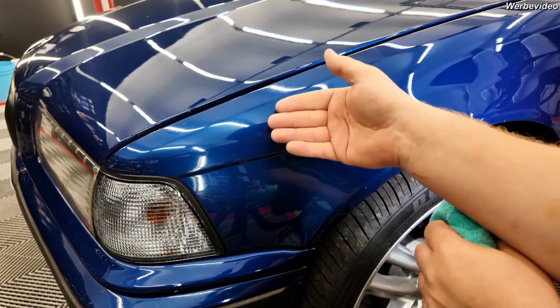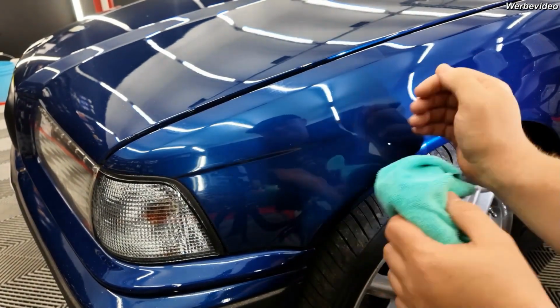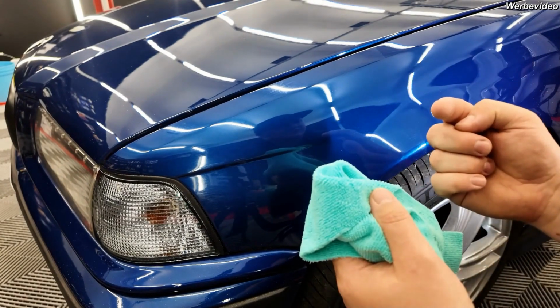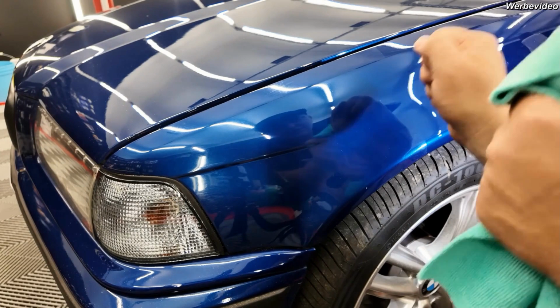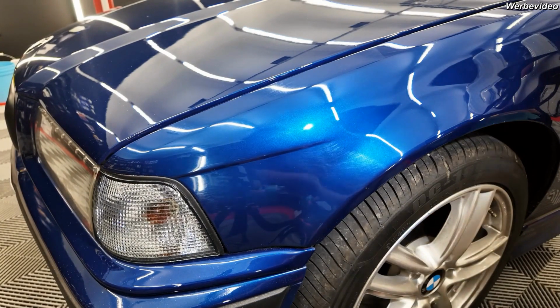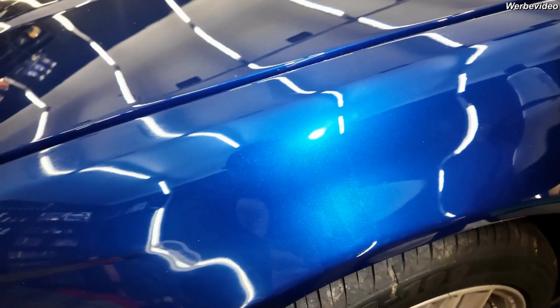Because we are really focusing on safety as the temperature builds up significantly faster and you don't need nearly as much mechanical pressure. And that's something you can't just change from an eccentric to a rotary polishing machine by simply saying, oh, I'll polish just the same and there we go. Take it nice and slow with good pressure. Let it work. This can really go wrong with rotation. So you need to be very, very careful. I'll pull you out of this situation.